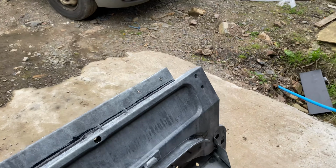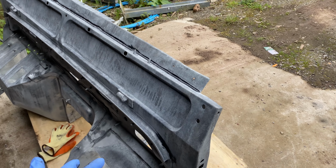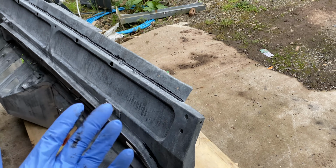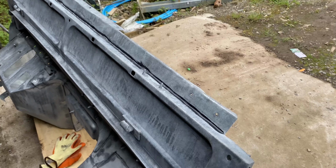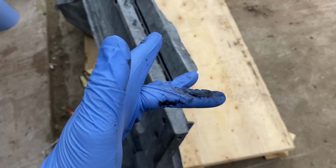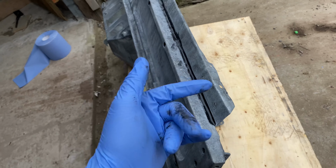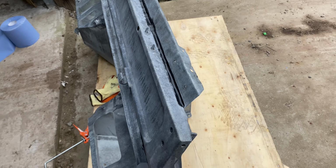Yeah, so the galvanizing doesn't go everywhere. If a seam wasn't cleaned up right, the galvanizing won't go into that. It's not that thin. So like this, we've sealed it. I've rubbed it with my gloves. That's why I've got rubber gloves on, because this stuff's really sticky. Just use the glove and then paper towel to clean up.